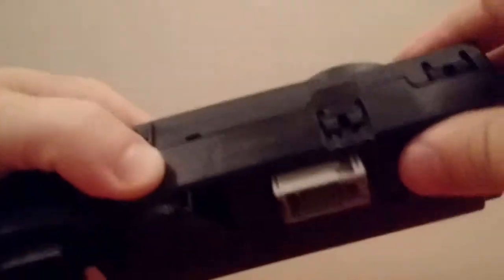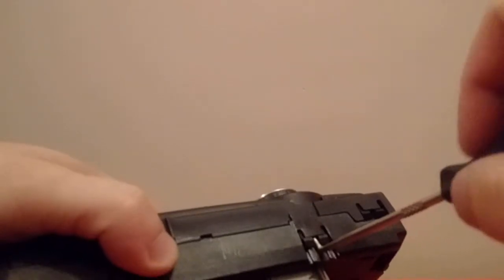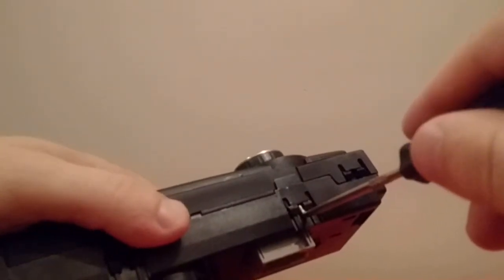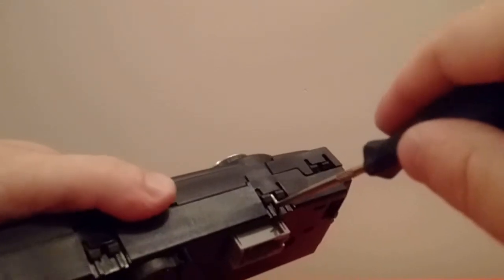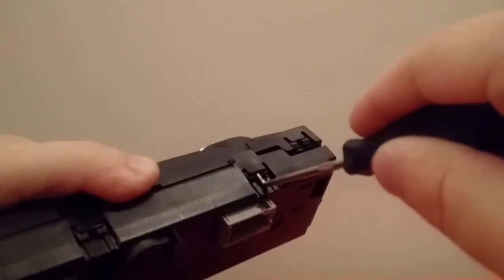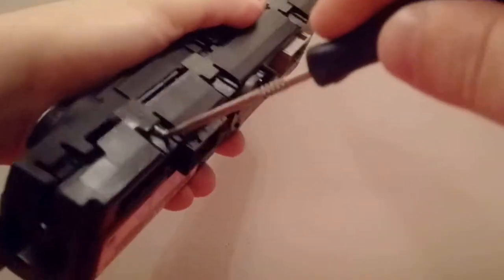I just want to point out why this works so good. When you use a flat head, you're gouging in there and it's not even doing what you're trying to get it to do — it almost acts like a wedge. It technically puts more pressure in there, not helpful, and you're trying to force things out. With this 90-degree pick tool, I'm getting right into where the two pieces of the clip connect, I'm pushing back, which separates them from each other, and it pulls away. It literally starts pulling its connection apart just by going in and doing that. I can't believe how simple this is.